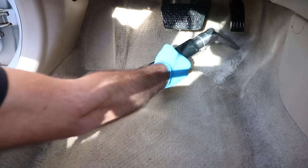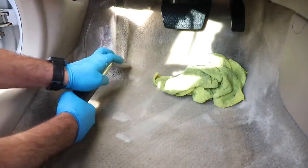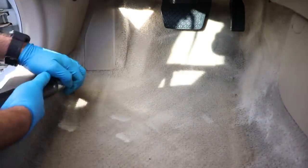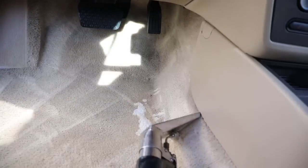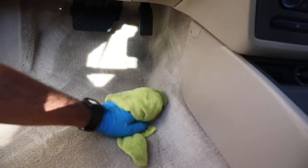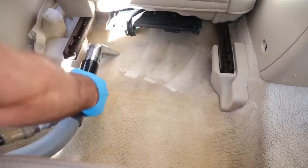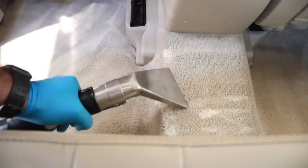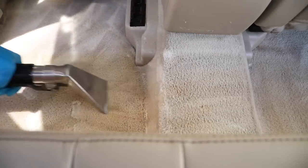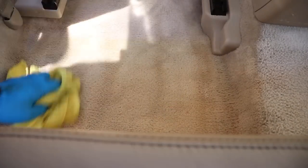Let's get to extracting — we're going to extract all the carpets in here. It's basically to pull out that cleaner and any stains that didn't come out with the steamer or the drill brush. When using APC cleaners, those are high alkaline cleaners — if the cleaner residue is left in the carpets and is not neutralized and extracted, it may cause re-soiling later. When it dries and is reactivated by moisture from your feet, it will re-soil. So we use a fabric rinse in our extractor to leave the carpets pH neutral or slightly acidic, which is where they want to be.